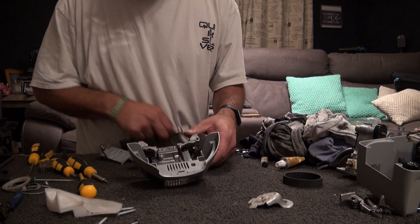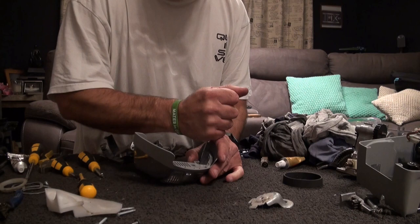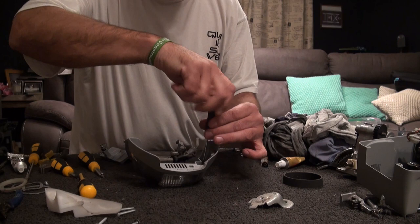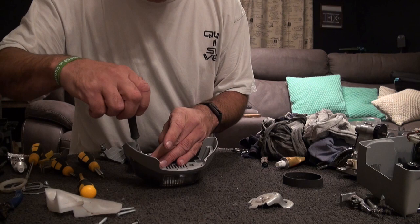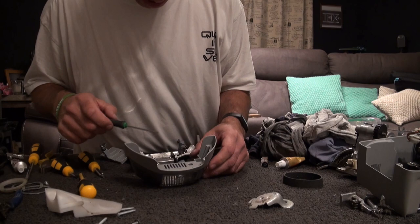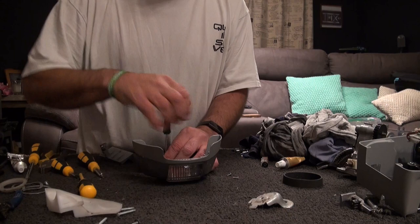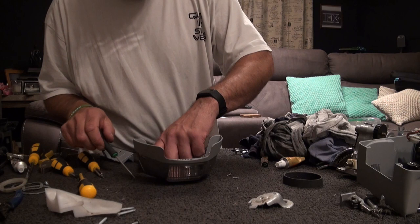So the headlight assembly, let's switch through those screws which I showed you earlier. So what we'll do is just undo those. Quite small Torx. So again, I've done the screw there. Unscrew there. Now don't try and pull this out, you've got to release that hinge. Otherwise you're going to snap something or bend something and it's not going to sit correct. So there's your two little Torx screws. Okay, let me undo this hinge. So, and this is purely just to polish it. Obviously if you need to change a headlamp bulb, it's exactly the same process.